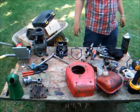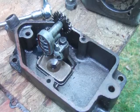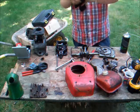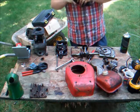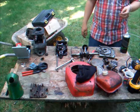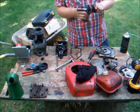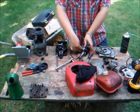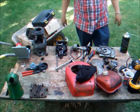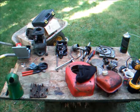Just going to clean up the bore and the piston. Testing the fit of the big end on the Suffolk's crankshaft — it's the Briggs & Stratton's connecting rod, which is badly scored, which is one reason why we're using it because it is past it. I think the Suffolk's connecting rod is pretty good, so I want to save that. We're probably going to have a noticeable big end knock, but that'll be fine — we're not going to run this for very long. It's just a bit of fun really, just to see if it can be done, because I know these engines are so similar that I reckon it should run just fine.